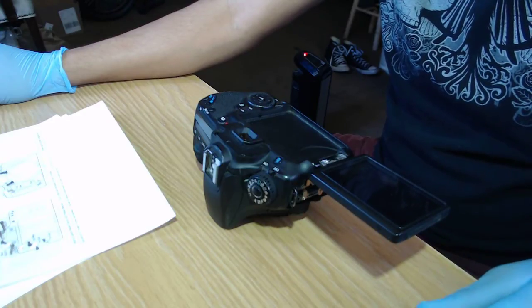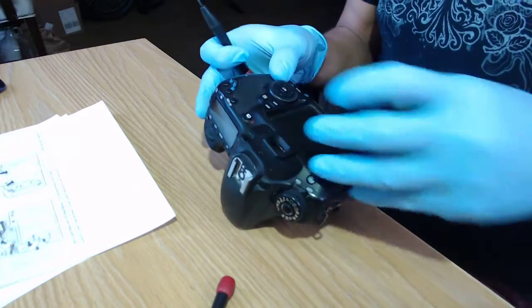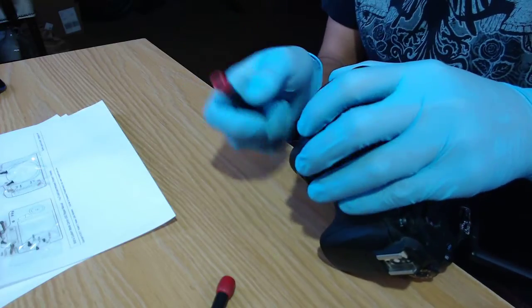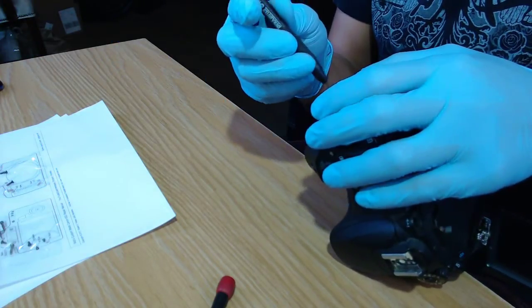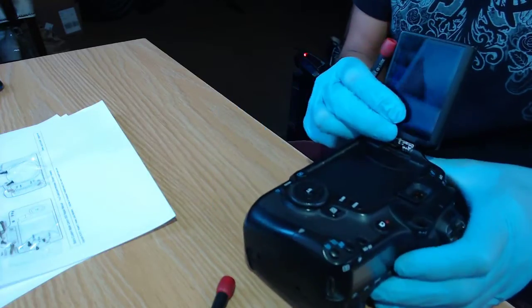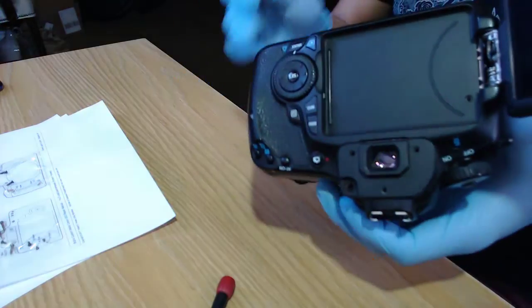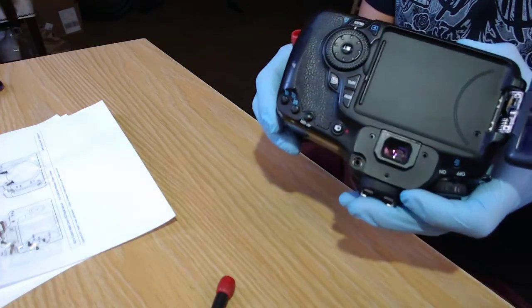Just start by taking a small screwdriver and putting it right on the edge here. All right. Oh, cool. Very easy. And just lift just a little bit. Once it starts to come up, that's all you need. Now you may need to adjust the LCD screen just slightly as you lift it off. And be careful when you pick it up, because there's a flat ribbon cable connected right here. Just lift up on the edge of this connector and it'll come off.